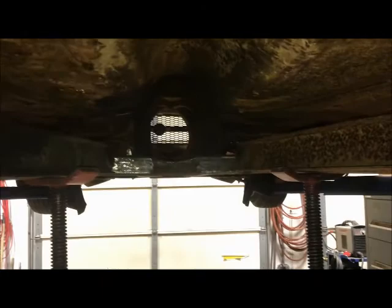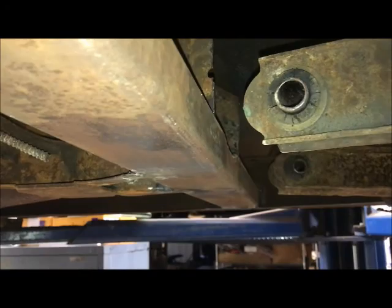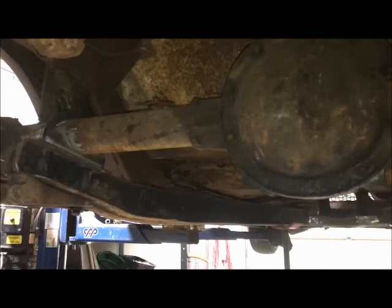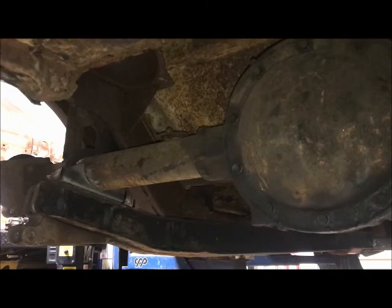So if I can't source a set of truck arms, I could always go with a four link or something else. I just like trying different things and seeing what works. So anyway, I've got the arms basically just sitting in place. Now I've got to make up some tabs to tie the arms to that cross member there. Everything is just bolted down tight at the rear axle. And once the front mounts are done, I can cut the rear loose, take a look at shock mounts and such, and then I'll be at the point where I can put the springs on it and make this thing roll. I want to get this done as soon as possible so that I can get that Mustang in here and get that thing stripped and scrapped out and gone, and get back to this and the stuff that I want to do, instead of dealing with the Mustang.